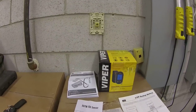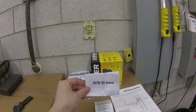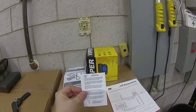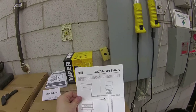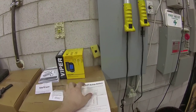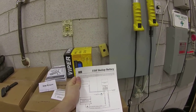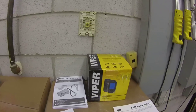Now I mentioned that we did a bunch of advanced sensors. We did the Directed Essentials 507M Digital Tilt Sensor. We did the Directed Essentials 508D Double Guard Field Disturbance Sensor, otherwise known as a Proximity or Motion Sensor. We also did the Directed Essentials 520T Backup Battery for the alarm system. This backup battery system is pretty cool in that if the main vehicle battery is disconnected, the backup battery module will not only trigger the alarm but also provides proper recharging of the backup battery.